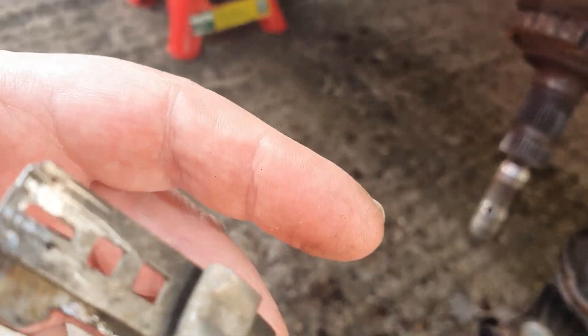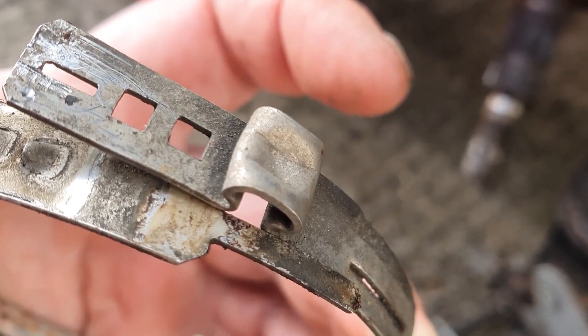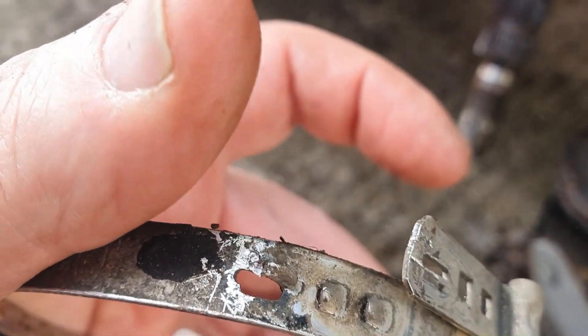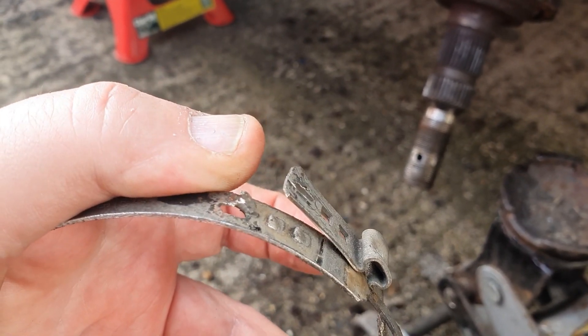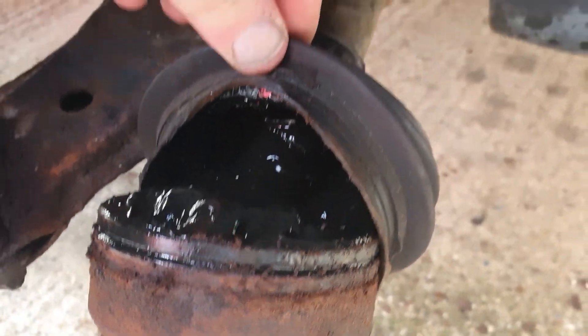Next stage is to remove those clips from around the boot. These are a little bit of a pain — they work well if they clamp well, and these were. There's a little bit of metal sticking up that clips into grooves, and then you scrunch that bit up, which tightens the clamp onto the boot. I just chiseled that little bit of metal back, put a screwdriver under this piece, and they popped out. Now you can see what I mean about this being disgustingly full of dirty black grease.